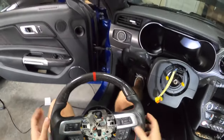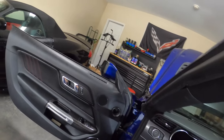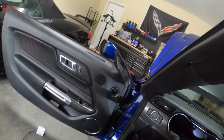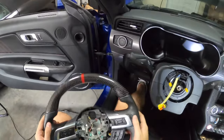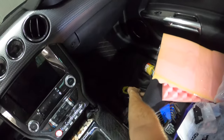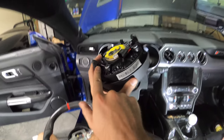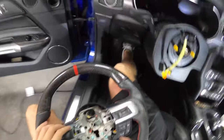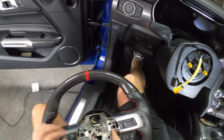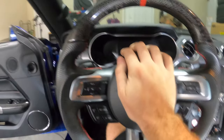All right guys, we're in the home stretch. I have transferred over all the steering wheel controls. My garage is a complete mess right now — I have fluids to do on the Viper and the Corvette, mufflers over there, still waiting on coilovers for the Viper — so I did the controls in my lap. You can actually see here where the airbag grabs on and how the airbag mechanism works: inside there are these grooves, and when you push the airbag in, it grabs onto these springs.